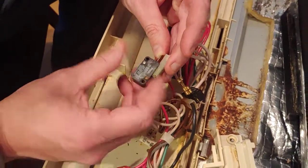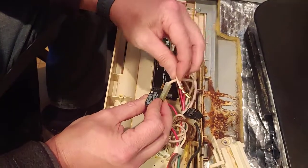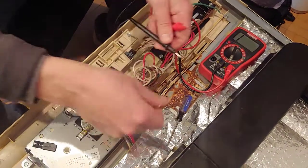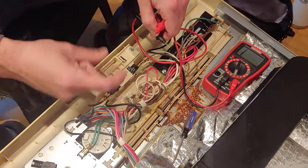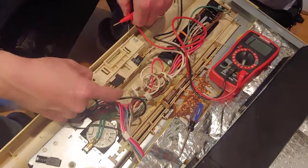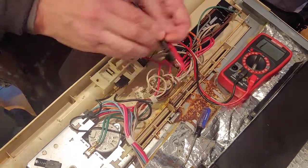The switch has two terminals here. Every time that button pushes in, it's connecting these two wires — that's just the basics of a switch. If you want to check whether the micro switches are actually working, they just work on an open/close cycle. In this case they're normally open, and when it's latched they're closed and make a connection — literally that wire is touching that wire when that tiny button is pushed by the latch.